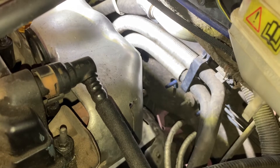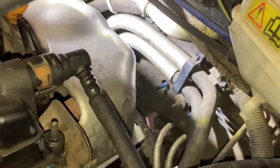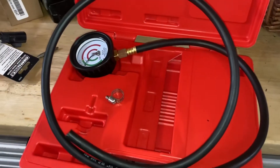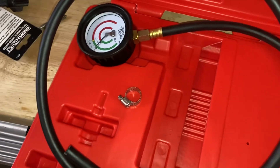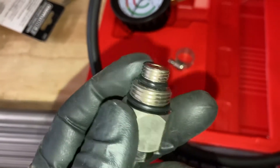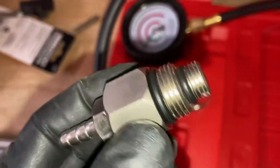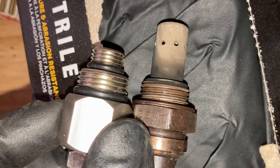I'm going to get my exhaust back pressure connector hooked up and we'll see what kind of back pressure I'm getting. This is my exhaust back pressure gauge — just got it in from Amazon this morning, it's roughly 50 bucks. The idea is to screw this into your O2 sensor port. One of these will be your threaded interface, and most of them are the larger M18 by 1.5 thread.